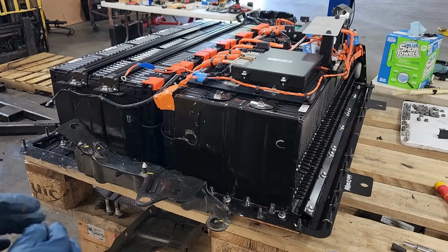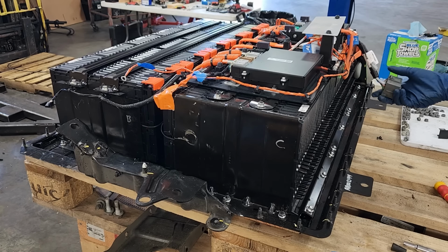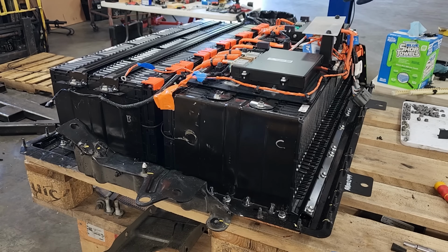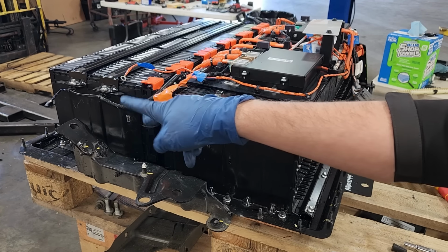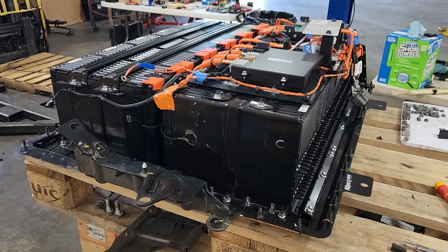Alrighty, we're gonna go ahead and get our other side panel piece on here. I've got my sealant applied to the areas that I need to on that. It's going to be a little bit tricky because it's a bit of a juggling act to get everything in. I need to get the data connector input onto it. I need to get the cable from the output on that center plug onto this contactor, and then I also have to get the bus bars for the disconnect connected to the modules on this side. So it'll be a little bit of a juggling act, but we'll get it done.